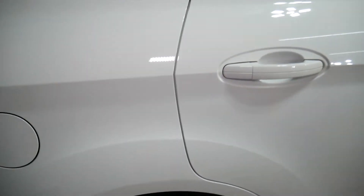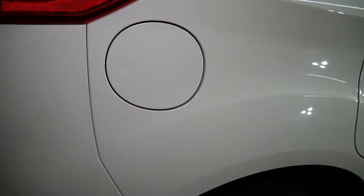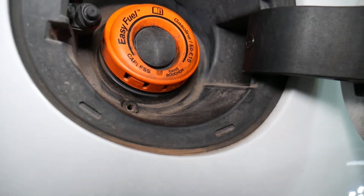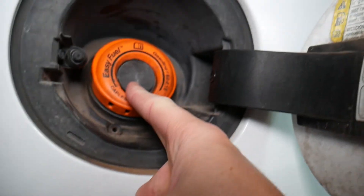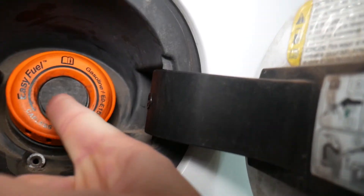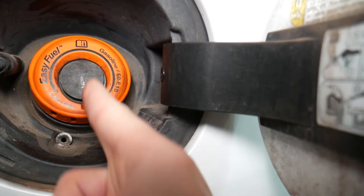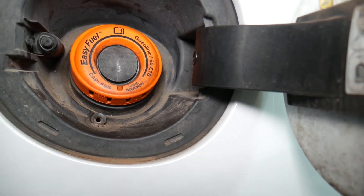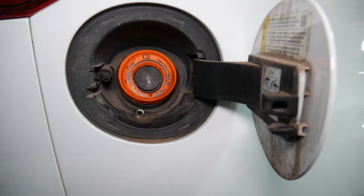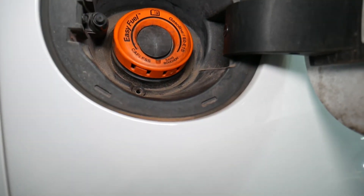The second thing that can cause these codes: come to the fuel door and open it. On newer cars it's capless — there's no cap. Back in the day you could blame these codes on a loose fuel cap, but now the seal is integrated around the flap. There's an O-ring on the inside — if it fails, is dirty, or doesn't seal correctly, you can get these codes. The cap also has an integrated valve that releases pressure if it becomes too much, and if the purge control system isn't working, that can cause a problem. A link to a replacement cap is in the description below.